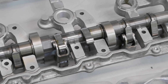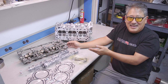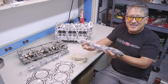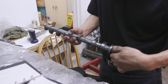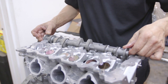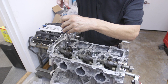Through electronics and tuning, you can actually get the advantages of a race cam without having to get a cam. Everything is on the exhaust cam — JWT makes an exhaust cam with more lift and duration, and that goes on this side. The exhaust side is a conventional VQ valve train, so we're going to be changing the exhaust cam, leaving the intake side alone and messing with it electronically.